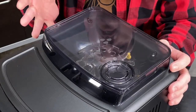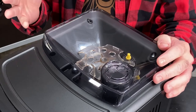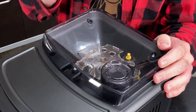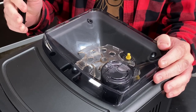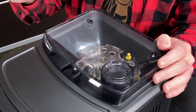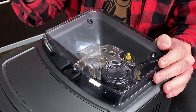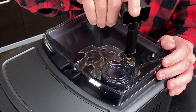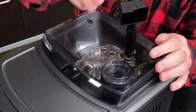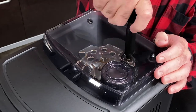For our final step of setup, we're going to get our grinder calibrated before we add our coffee. Remove this lid here. It's important to get your grind set before adding beans for a few reasons — first, it's just easier to see the post. Second, adjusting the grinder with no coffee in it is much easier than if you add beans, make a few shots, and then have to make an adjustment. If you're ever adjusting the grinder when you have coffee in it, you can only make a single adjustment at a time before having to grind a new shot and then adjust again. If we have it empty, we can freely adjust wherever we want. Simply take the post and line it up with the socket. There's a little arrow that points to where we are — 10 is the most coarse, and the finest setting is all the way over on the other side. To adjust, it's kind of like taking the cap off a medicine bottle: if you simply try to twist, you won't get anywhere, but if you press down and twist, you can adjust the grind setting.